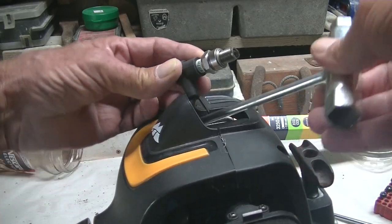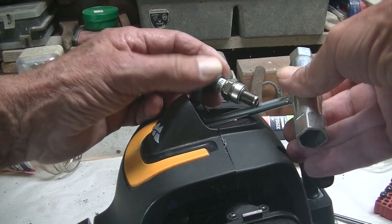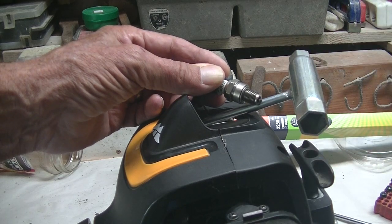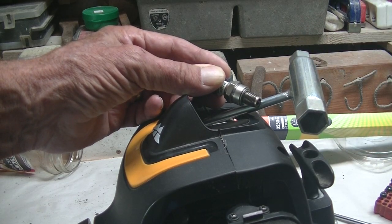So I have ordered a spare coil. The first thing we're going to do is go into the barn, into a dark place, and see if we have any spark. After that we'll take measurements of the coil, because I don't actually have the correct specifications for that, so I don't know what it's supposed to be. But we can work it out, I'm sure. Okay, so I have my screwdriver pushed into the side, touching a metal part, and I'm going to attach the spark plug to the screwdriver, turn off the lights, and we'll have a look for spark.